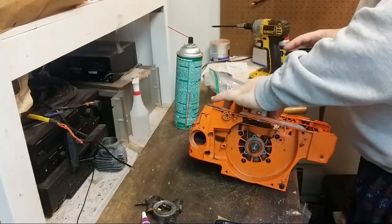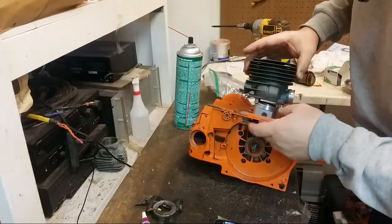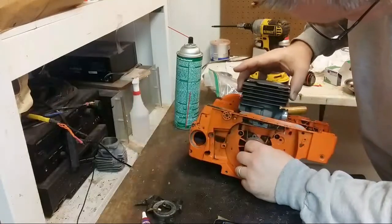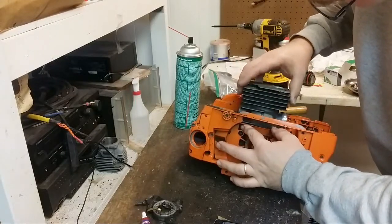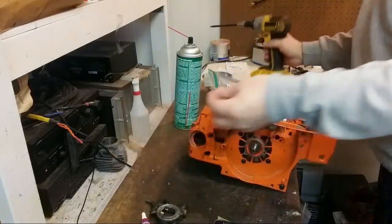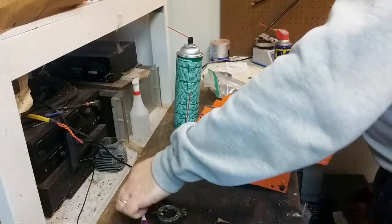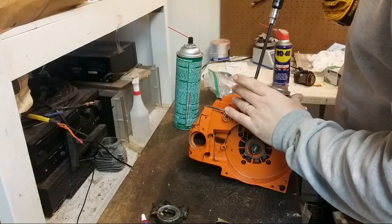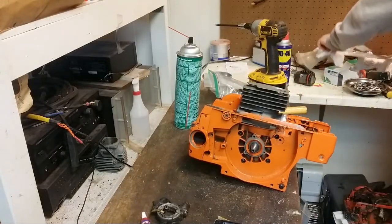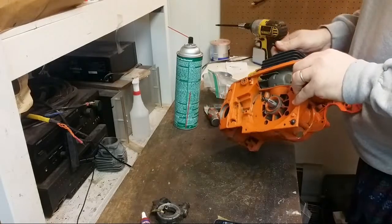Now, no rock now. That's frustrating. Like, geez, I thought I clearanced it. I did, but not enough, because I forgot about the other part of the measurement, essentially. I just put 2 screws in and measuring squish.